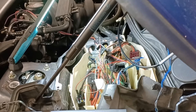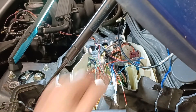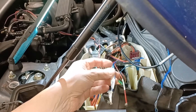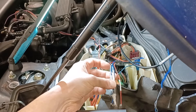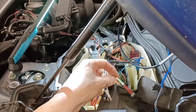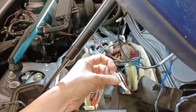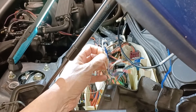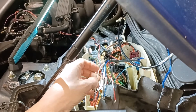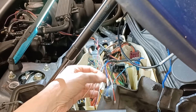To fit the AIM Solo unit, I've pulled the cable up through the duct at the back of the ECU box. There are six connections on the cable but two of them aren't used because they're for RS232 connections which I'm not using. That leaves four connections: I need one 12-volt supply, a ground — which is the black one — and then CAN bus high, marked on the cable as CAN plus.